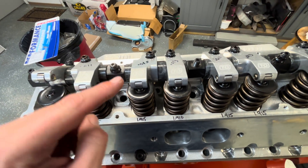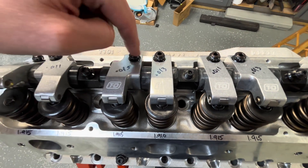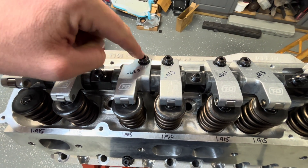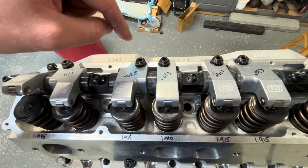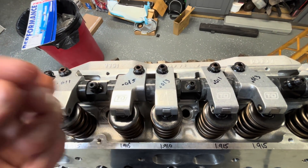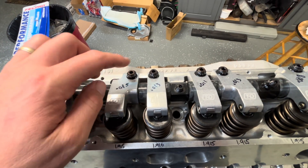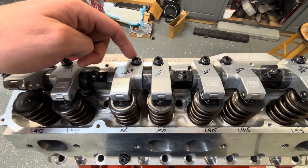What T and D says on the website, just as a starting point: turn that screw all the way out on your adjuster, and then turn it in one full turn and stop. They're very specific about oiling and the ability to get oil through the adjuster, but that's where they like it as a starting point. So I've got the adjuster push rod set.